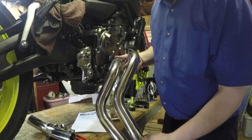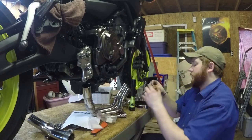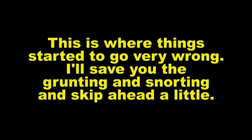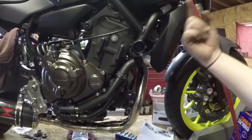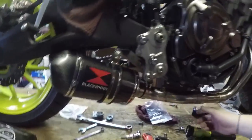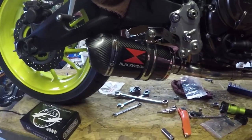That looks pretty close. This exhaust installation has its shortcomings. Time for the gaskets to go in — I'll install them into the cylinder head itself. What I ended up doing was putting the collector on the two pipes and using a little wheel bearing grease to hold the gaskets in place long enough to get the pipes seated. Got it in, slipped the pipe on, slipped the muffler on. This took some finagling — especially that little clamp around the muffler, which took a terrible amount of finagling to get right.